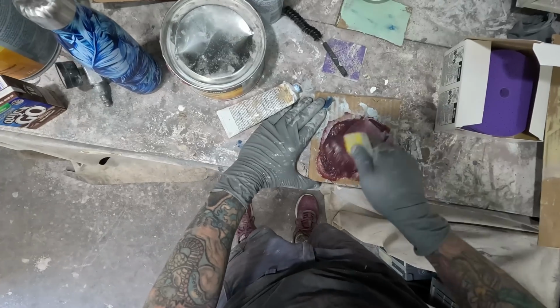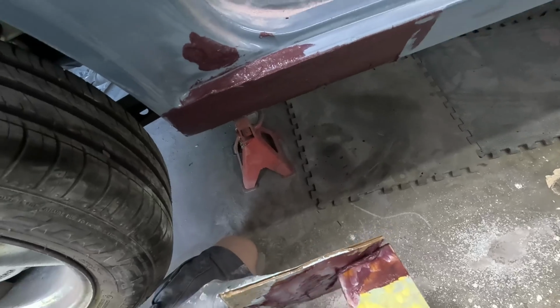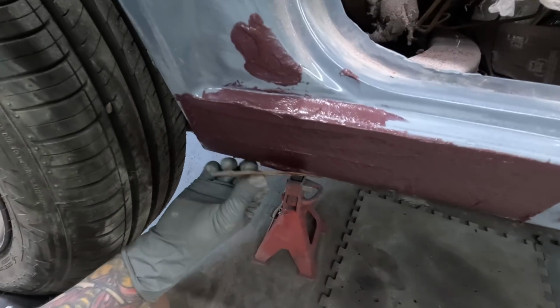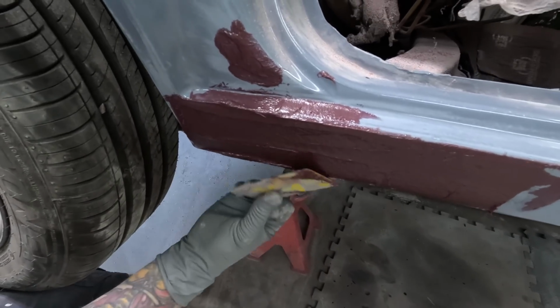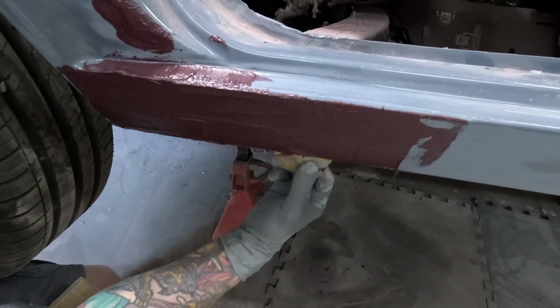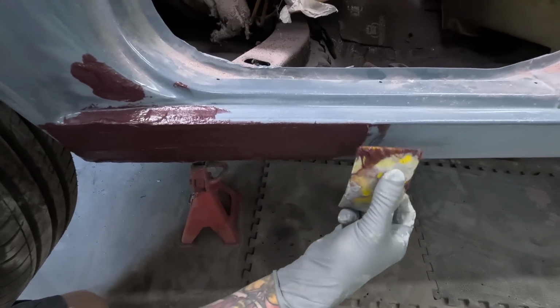So there you go, guys. That's about it for this vid. Nothing wrong with a bit of good old cave and pave. And if you're going to do it, just use fiberglass where possible, just in the deepest of the spots, like you see me doing there. Yeah, it's standard body filler. Yep, it's quite strong too. It's lightweight, but yeah, where possible in the deep spots, use a bit of fiberglass filler.